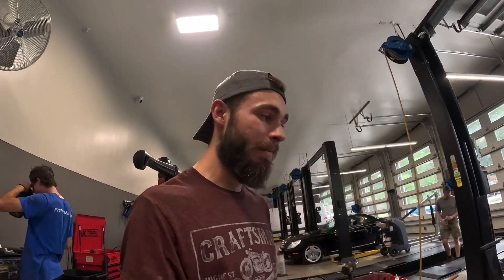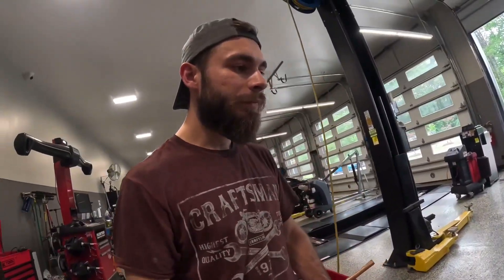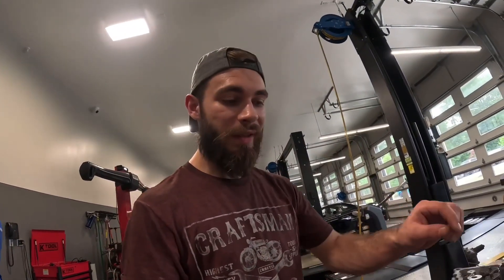What's up guys? Today I'm going to show you how to properly shim an FA-20 — the valves. These things are not self-adjusting. They have shims in them and you have to reset this when you need to do a motor rebuild or if you're doing any kind of head work on it. Or you can keep them in the same order, measure them, and make sure they're correct. But if you do any kind of valve work, you've got to check this and most likely make adjustments.